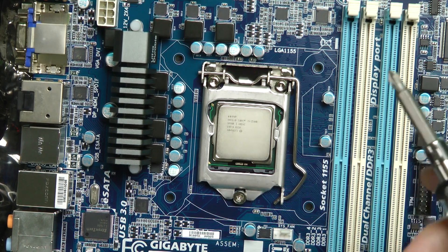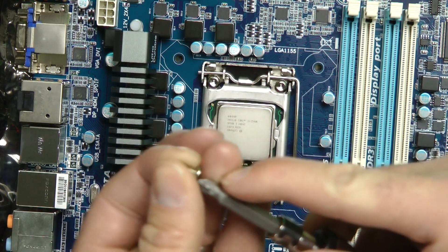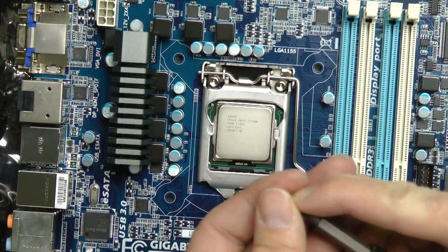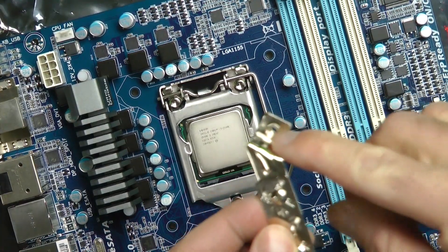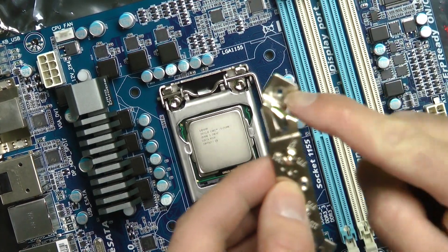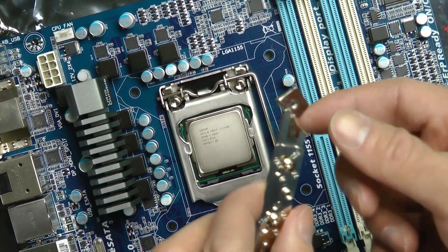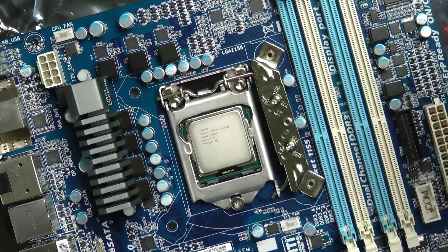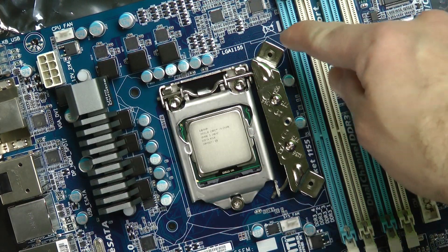I just like to be extra safe and not have any problems. You just put the nut on there, hold it, start the screw and it's a lot easier and safer. Actually I need to correct myself — you're not threading the nut down, you're actually threading the screw up. This bracket is going to go right here, and there's another bracket that goes underneath to sandwich it. You screw the screw from underneath because these holes are threaded.